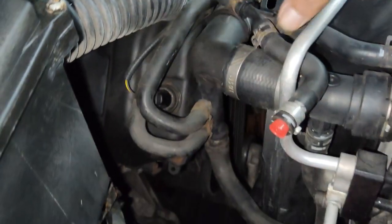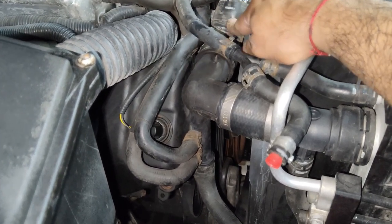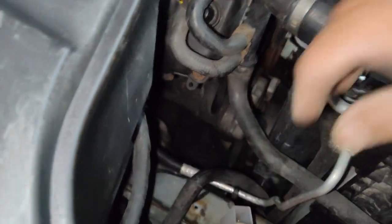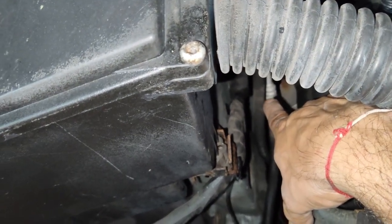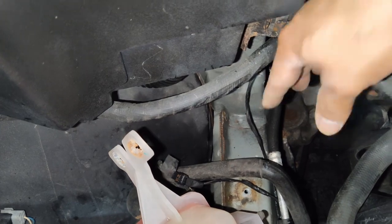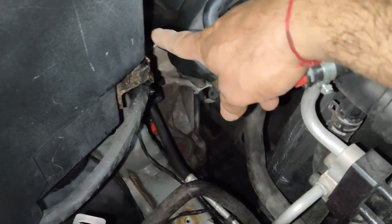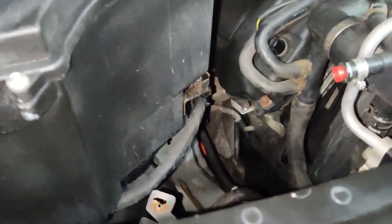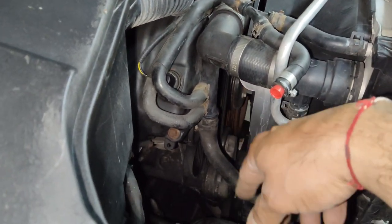Undoing the clamp and pulling the radiator hose assembly up was the only hose I disconnected. There was a minimal loss of coolant, so we will need to bleed the system after we're done, but that gave enough room to squeeze the alternator right out. I also undid the clip holding the AC line under the frame — that dropped the line just enough, because otherwise it was catching the alternator. Doing those two things — pulling the coolant hose assembly up and releasing the AC line clip — is what it takes to get the alternator out. Note: if you have a non-supercharged L322, this will be even easier.